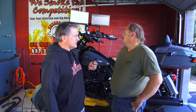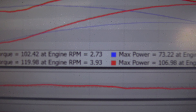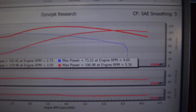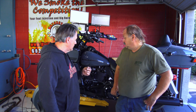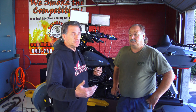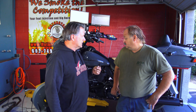So what were our final numbers? We switched to SAE — we were at STD before. Basically 120 foot-pounds of torque and 107 horsepower. That's pretty good. We started out at 102.5 torque and 73 horsepower, so we picked up quite a bit. Customer will be pretty happy with that. I'm really happy with the tune. You can see what it takes to develop a MAP — we've been here for at least a few hours, maybe closer to four. It takes time. Some are easier than others, and with the new torque-based tuning system, it's a lot trickier.